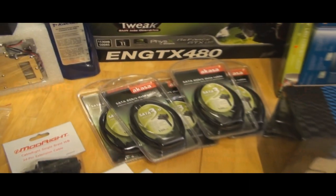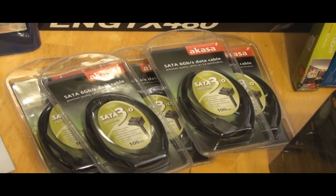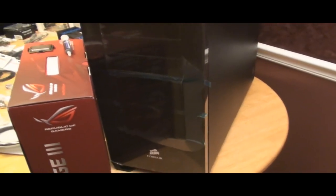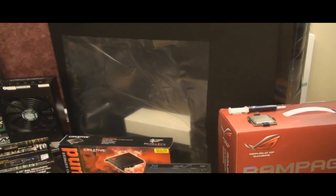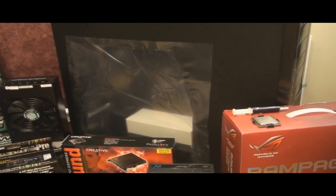Since we have Serial ATA-3, we bought Serial ATA-3.0 cables. You may ask why we bought cables when this case has a hot-swappable bay on the front. Well, I know this case has a hot-swappable bay, but it only supports Serial ATA-2.0. So to make it 3.0, we could not use that hot-swappable bay. I will still use the physical slots, but I'll wire them in for 3.0 instead of 2.0.